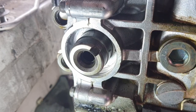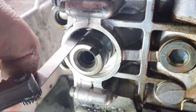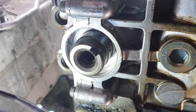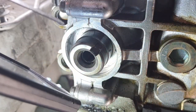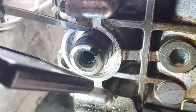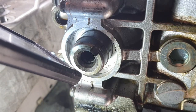I would like to attempt to get a visual on the sealing surface. Now, it's going to be really tricky. I don't know that I'm actually going to be able to do any kind of legit check of this, but I'm trying to just check because the seal rides along this where this mirror surface begins. And on very high mileage engines, which this is not one, the seal lip that rides around there can actually begin to wear that out. There's various types of products that you can use that slip over a very thin steel sleeve that'll slip over the end of the shaft and create a new sealing surface. I've heard good things about those, but I don't think this engine needs it yet,